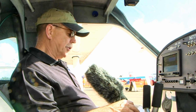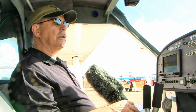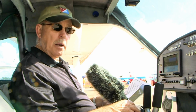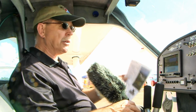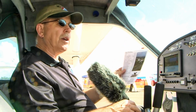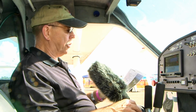We also did a series of stalls in it, as I mentioned, and looking at the indicated airspeed on the Garmins, I was seeing numbers that matched what's in the brochure. The brochure calls off 45 knots with flaps up. We didn't actually do stalls with flaps up, we had flaps down, so we were seeing numbers closer to the 40 number. We began to see a little bit of wavering at 47, 48 knots. And by the time the horn was going off, it matched the numbers required by the ASTM program.